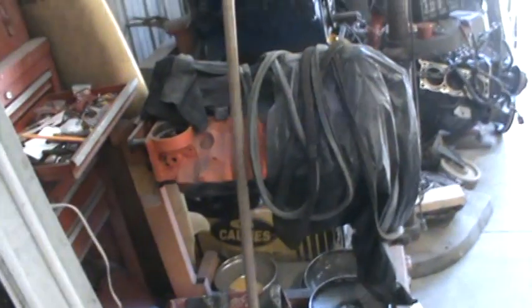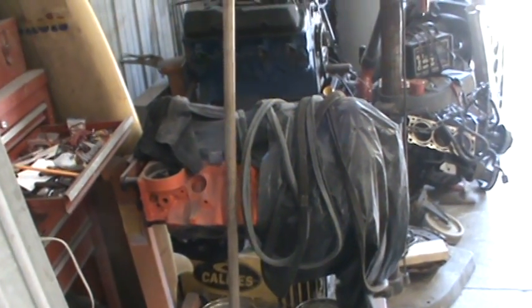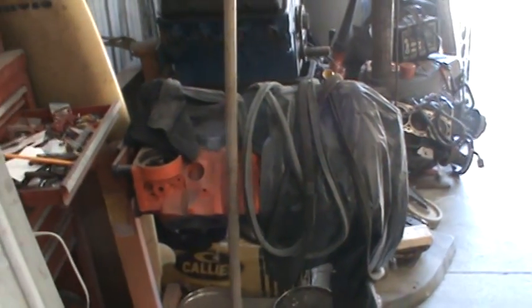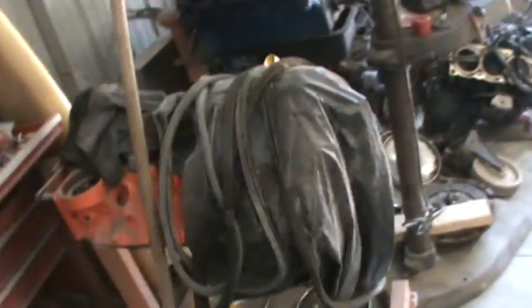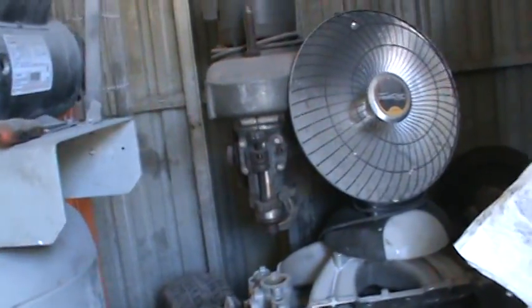Had to dig the old big block out here next. Looks like I need some freeze plugs. Probably have to disassemble that thing. It's pretty crusty looking. But I do got a pump and a pan and everything for it now. I got the heads. Probably about another 10 or 15 hours of port work, and I can reassemble those. And yeah, probably go ahead and put that together with the flat tops, just because I've got a pretty small thumper cam in it. It's the medium one, not the big one, not the small one, but the one in the middle.